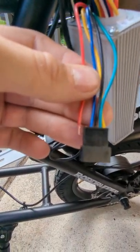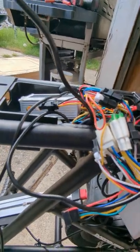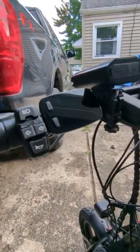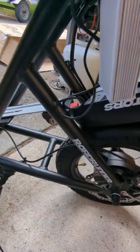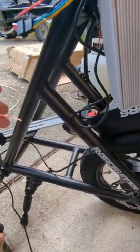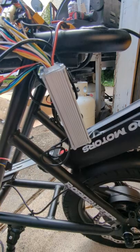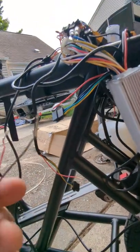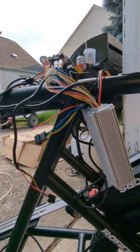That red wire used to be right there next to the blue. Plugged into that is this connector which comes from the frame on the left side, and that's coming from your speedo display and mode selection. It has the same wires: blue, black, green, yellow, and red. We're going to be working with the red and the black wire. We're going to connect red to red, and then the other red to the green — that takes the voltage that would have gone to the display and our ignition switch is going to switch that. Then we take the black wire and tee it in with one of the black wires on the controller, and that'll get us our ground for our voltmeter.